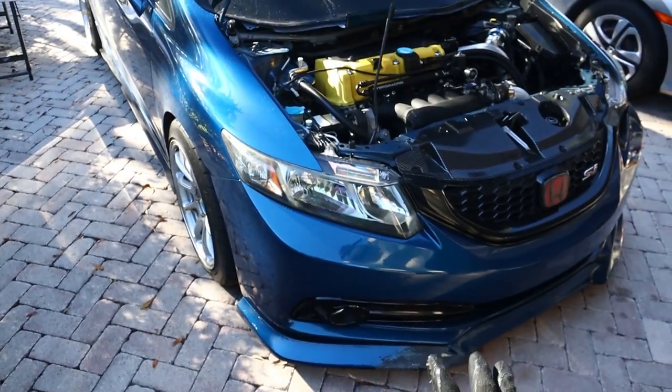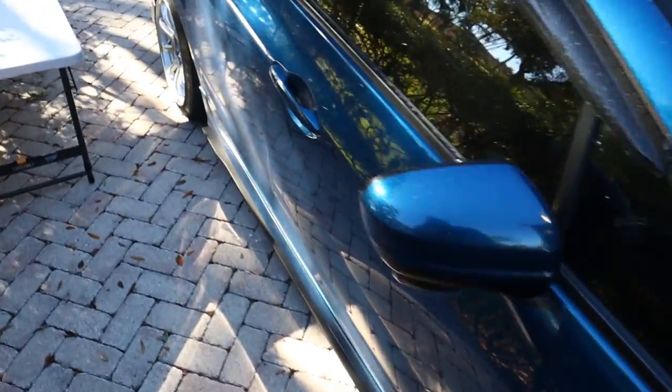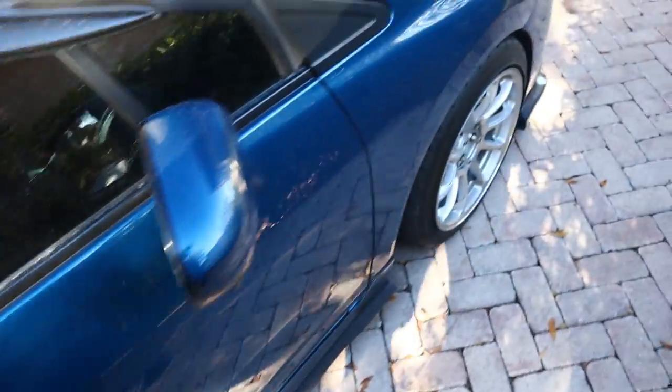You also need to jack up your car. If your car isn't low like mine, you might be able to get underneath and reach the valve — but my car is pretty low so I have to jack it up. You don't need to take off your wheels. The valve is on the back of the caliper so you can access it from underneath. If you want to take off your wheels, be my guest, but you don't have to.